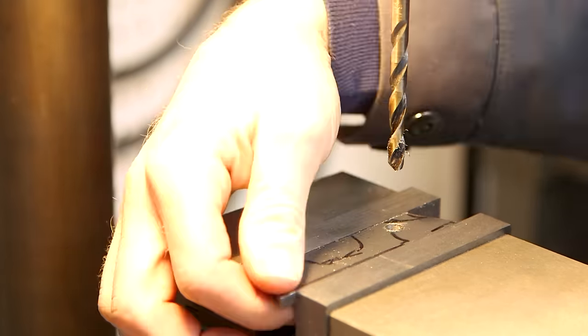I originally attached the brake hose to the frame using some cable guide adapters, but I really wasn't happy with that — the hose didn't fit very well, it looked really sloppy, and it covered up the decals on the frame. So instead, I modified the cable guide stops to hold the brake hose and installed a pair of rivet-on brake hose mounts. This gave me four mounting points for the hose, aligned it with where the original cable went, and kept it off the decal.